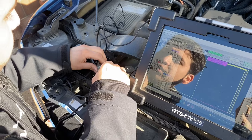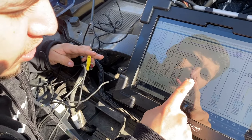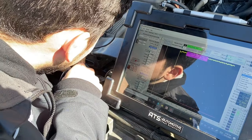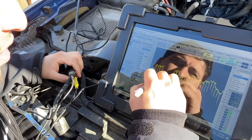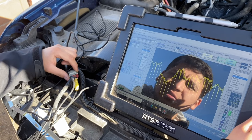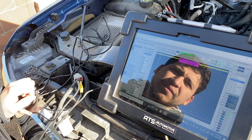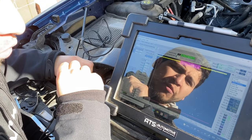Now what we've got to do is leave our ground here for our scope and go into the green wire — our LinBus wire that goes to the PCM. Let's stop this, start again. As you can see, it's not sending out what it's supposed to send out. It's shorted internally to positive. Basically, it's supposed to be like a five volt square wave — but when we look at the waveform, it's not supposed to look like this at all. This is straight 14 and a half volts — battery voltage. We're supposed to have a nice square wave for the bus, and we do not have that.